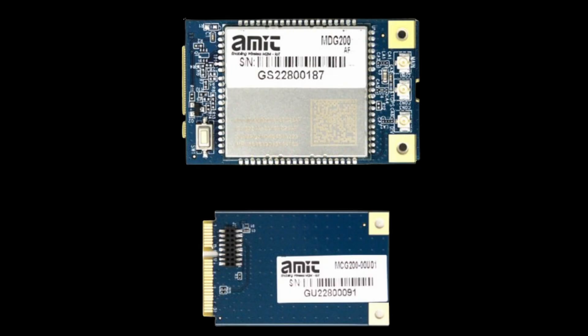My box is configured with a cellular modem card and 16 GB of RAM. It does go up to 64 GB, but on an OPNsense firewall with not many clients behind it, I didn't really need that — so I opted for just a single 16 GB stick, which is plenty, along with the cellular card. I put in a 256 GB NVMe — tons of space. OPNsense doesn't really need much, but I wanted the space for logging and maybe some other features and software.